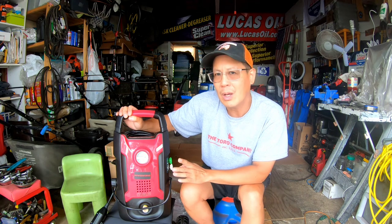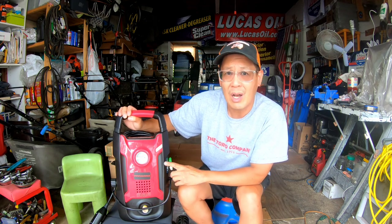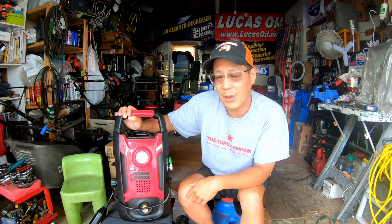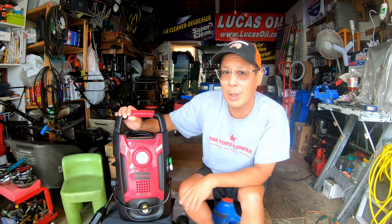I've had about three of these in my entire life. When I first bought this house 20 years ago I bought an electric power washer just like this. They usually range between $99 and $120 - you buy them online, Amazon, eBay, whatever. The electric ones I've only used once or twice a year and before the following year it wouldn't start or broke. One of the reasons is because there's a little maintenance needed - after you use it and store it away, you have to make sure all the water is out of the hose and machine because the water will rust the innards of the motor.